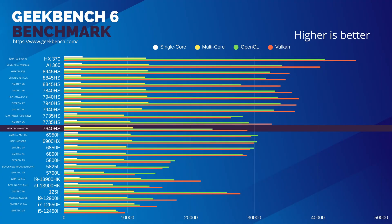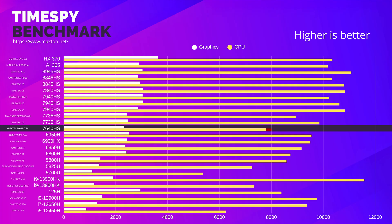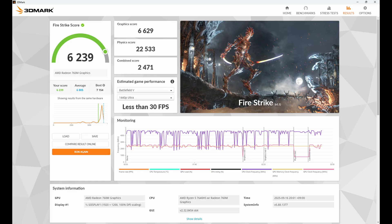Let's check out some benchmarks. In Geekbench, the M6 Ultra outperforms the 6000 8-core series in both single-core and multi-core by a solid margin, even beating out the 7735HS — basically a rebranded 6800H. We get a slight boost when using performance mode in the BIOS. Time Spy sees the score drag a little, probably due to the 6-core limitation. Remember, these are only synthetic benchmarks and only a slight indication of how the machine performs.